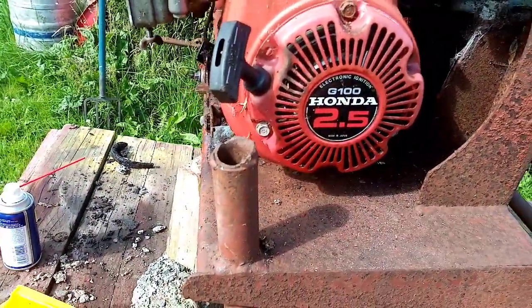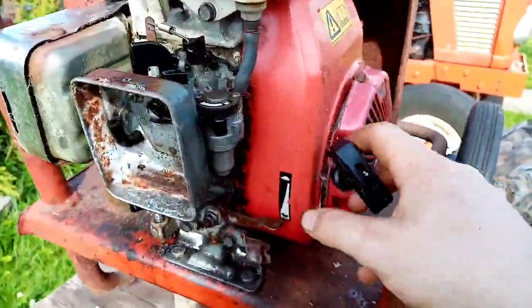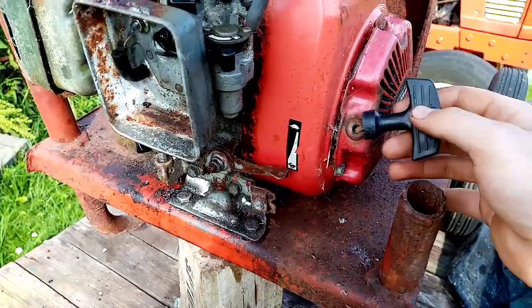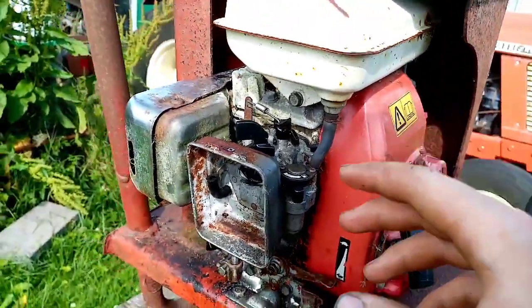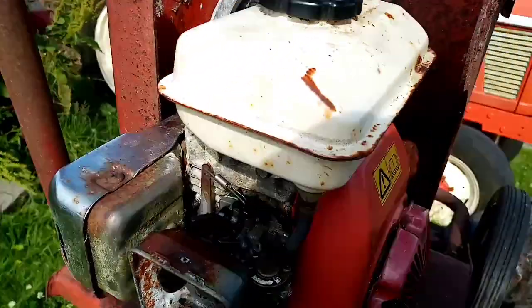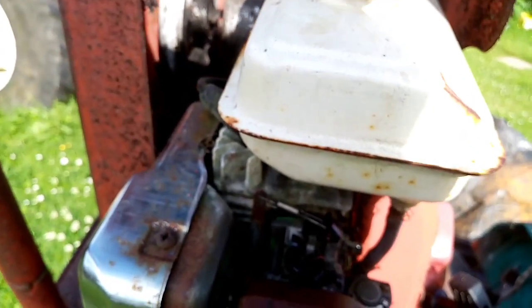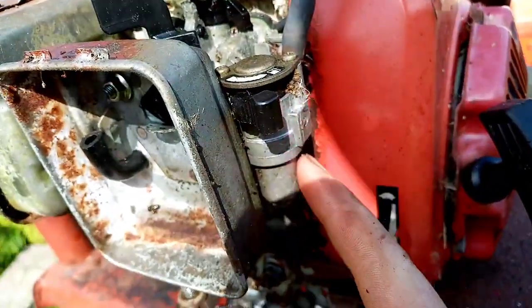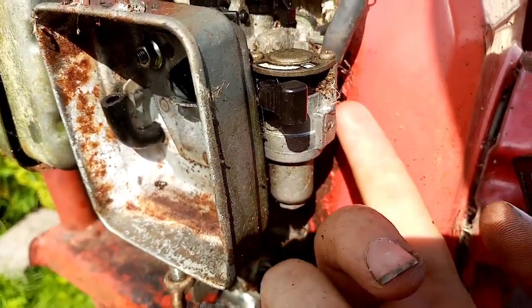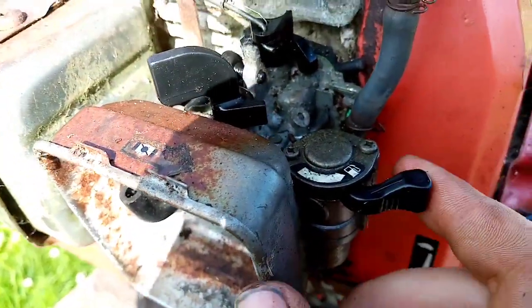It's a little Honda engine, 2.5, Japanese engine — very, very good. It's not seized or anything. When I pulled it out it was all covered in nettles, briars, everything. I pulled it over and it just turned over. I've cleaned out the tank — the tank was filthy. There's a catchment on the side, kind of a second bulb that catches dirt before it enters the carburettor — very good design.